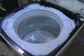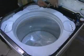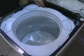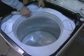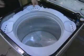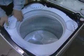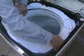To remove the basket hub, the lint filter, and the tub ring, be sure the washer is unplugged or the power is disconnected. Raise the cabinet top, then loosen the clamp and pull the recirculation hose off of the tub ring. Pry out and unsnap the tub ring tabs from the tub and lift the tub ring off of the tub.